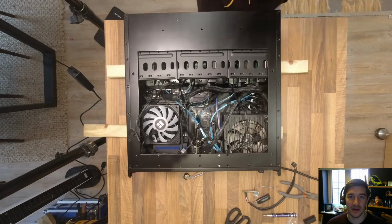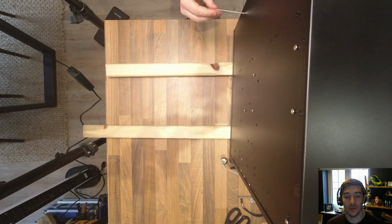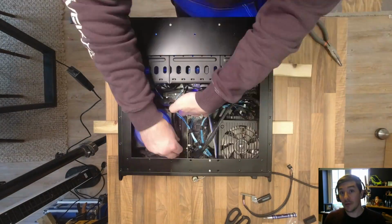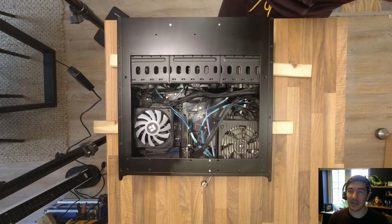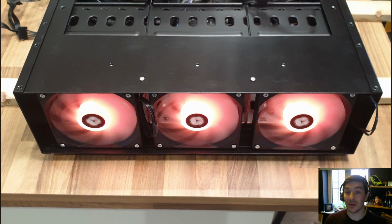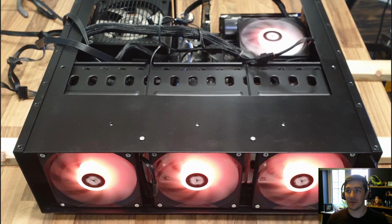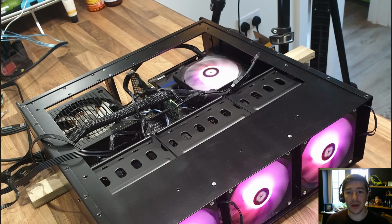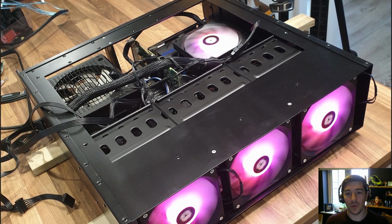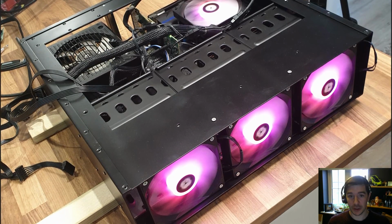I don't want this to be a multi-part video, but the next one will be the finale with the window, all of the back panel, the magnetic mesh, hopefully with some more hard drives in there as well, because currently there's only three Iron Wolf Pros, 4 terabytes, and one of them's parity anyway. And then I've got 2 SSDs, not M.2s, 2.5 inch drives that I intend to replace because they don't have DRAM in them, and I will be replacing them with M.2 SSDs for the cache.